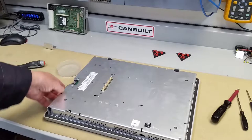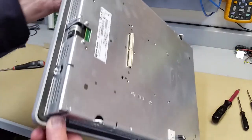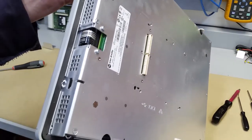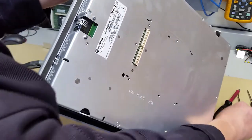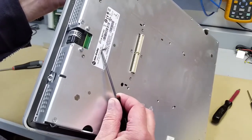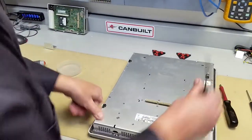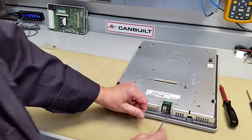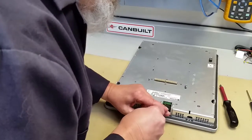Now, probably hard to see, but there is the ribbon cable. This ribbon cable ties the touch screen to the processor board. Normally what I do is I've got this little tool here — it's for an oil seal pick, for taking oil seals out of bearings. I find that it works really well for getting this unfolded out of here without damaging things.